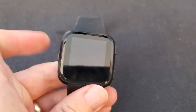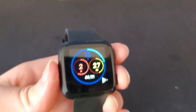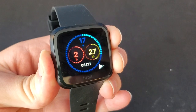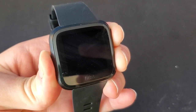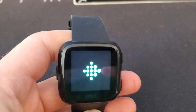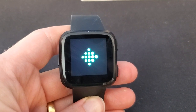If the watch is on, you're going to hold down all three buttons at once. Press them all in and hold for about 20 seconds. First the watch face will blink, then it'll go totally blank, and then you can release them. You can see the Fitbit logo comes up showing that it's restarting.